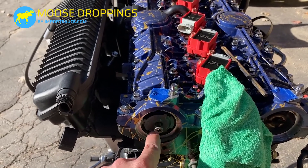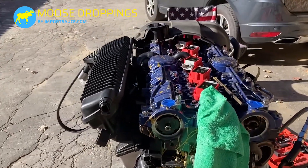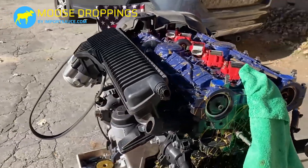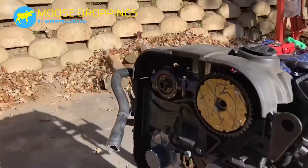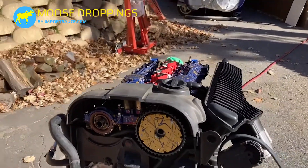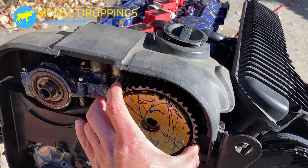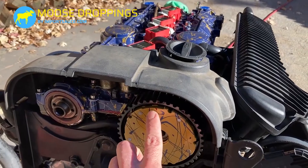You could look at them and based on their orientation take a picture before and say, okay, that is our top dead center. But this is important because in our situation, when these came off for paint and for building this engine, we had these spun — and without the bolts in, these can spin around. So you could theoretically get these marks off of alignment.